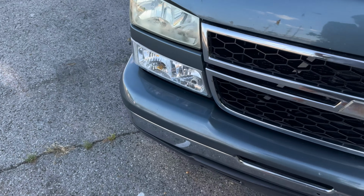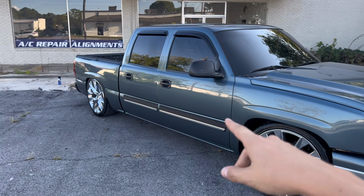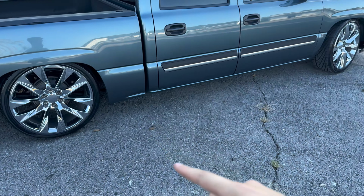Now I'm gonna crawl underneath this thing and hope that y'all can see what I'm talking about. No, that was dumb. I'm not doing that. So the spacer was only about 3/4 of an inch thick, but they told me in the instructions when you put them on the bottom of the coil spring, it actually levels your truck 2 or 3 times that height. Didn't really believe it, but it did work out. And I remember saying earlier in this video that I wanted the front of the truck to sit at the top of the tire, and back here in the rear to just barely tuck, and that's exactly what it did for me. So we're sitting at a -8.